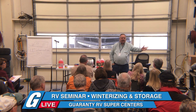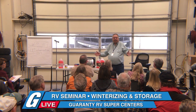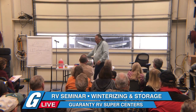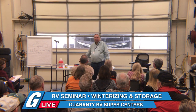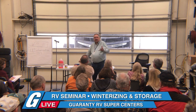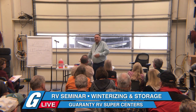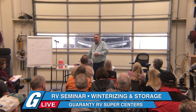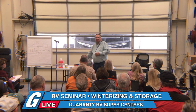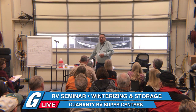These RVs, pick one. Let's say you have a used 1984 Cascade camper, low quality. It is designed with this kind of pipe plumbing. These coaches all are designed to live at anywhere from 40 to 60 PSI. The newer stuff, from the turn of the century on, 2000 or newer, are designed to live with pressures of 60 to 80 PSI. So it gets ugly at around 80 PSI. If you've got a coach with 100,000 miles on it, you're gonna hook up to 80 PSI. You're gonna find every little loose fitting, every little crack, every little thing in there, because that's pretty good pressure.